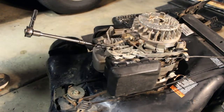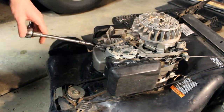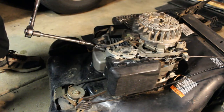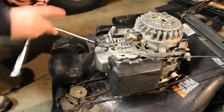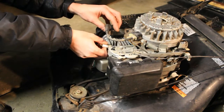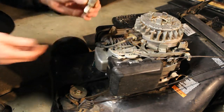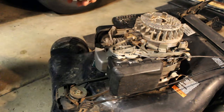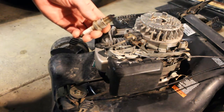Our recoil is done — I've wiped all the plastic down on the tank and that's drying. I think the next thing I'm going to do is check the spark plug. We'll remove it, put the recoil back on and give it some turns, and see if it's producing spark. The spark plug is pretty black, but we can clean that up. We'll take a wire brush to it and clean it up right now.